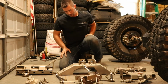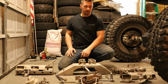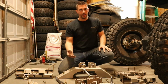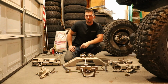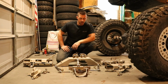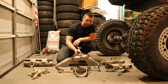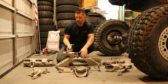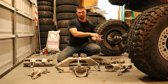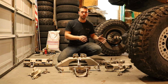So basically, the way this mounts is you have your passenger and driver side tube clamps, and that's what holds it in place for the most part, but the pinion brace is just like an added support. Some people are concerned that the axle tube itself is going to spin inside the truss assembly, and it's a valid concern. So I came up with this pinion brace that bridges between the truss itself and the casting. So, you know, with your pinion casting out quite a bit off of the center line of the axle tube, it provides a lot of leverage, more or less.